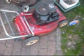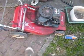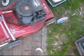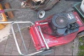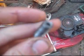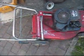I've just had a look at this Morrison, and I've cleaned the carburetor, and the gasket in the diaphragm in there seems okay. It's not great, but I didn't realise it didn't have a blade on the bottom, and the actual bolt was broken off, so I used easy outs and got that out, which is really lucky, because I haven't had much luck with easy outs before.